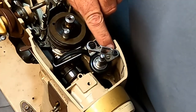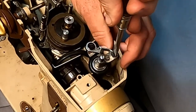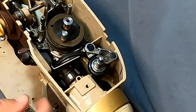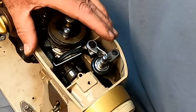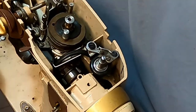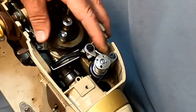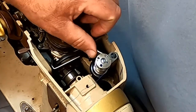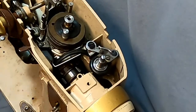You want to make sure you don't pinch the spring under this screw, so just keep it centered. Clamp your screw down. There's supposed to be a stem from the motor coming up here — this motor is removed, so it's not here. But you can see when you put it into place, we pop a bobbin on there, push the tab, and it locks it in. This will hit the wheel and it'll wind. Then, once your bobbin's full, it releases it and off it comes.